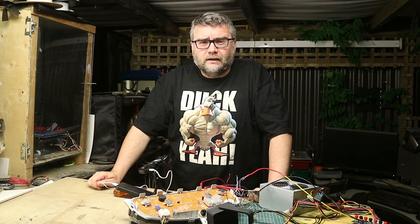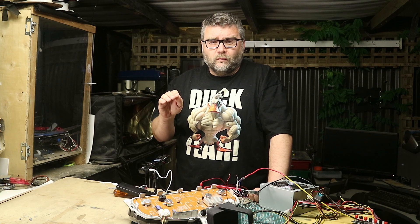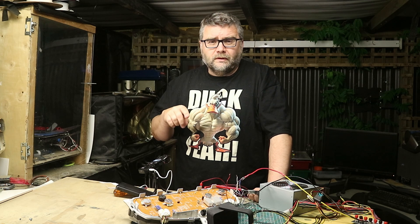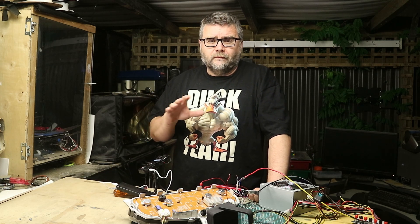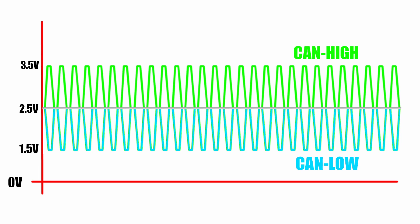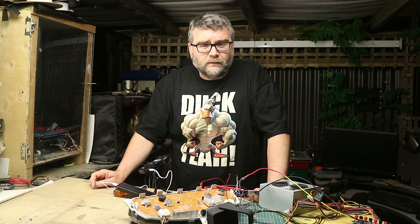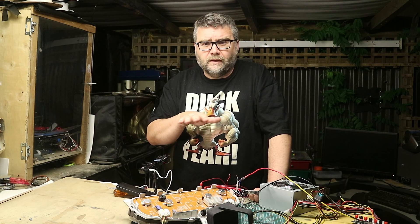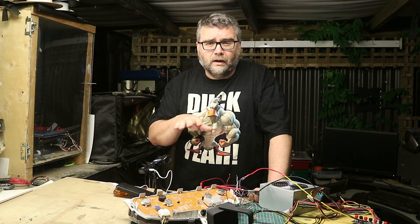To find our CANBUS lines, we need to learn a little bit about CANBUS. It works at around two and a half volts and has two signals. One is called CANBUS high and one is called CANBUS low. CANBUS high will drive up to three volts and CANBUS low will go down to about two volts, swinging between those two voltages to send signals between the ECU and our device. When not connected to anything, the signal freaks out and continuously sends around three volts on CANBUS high and around two volts on CANBUS low.